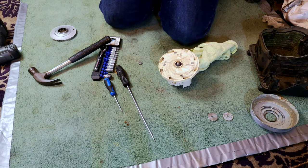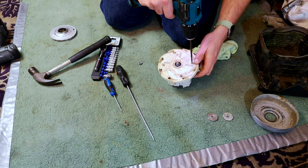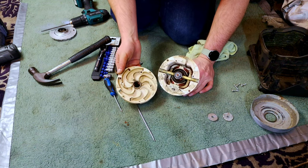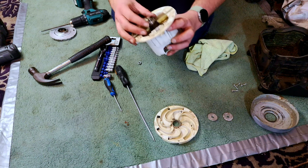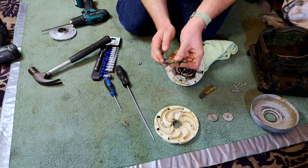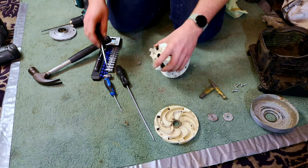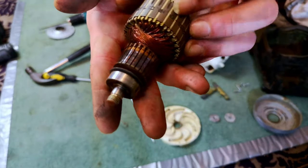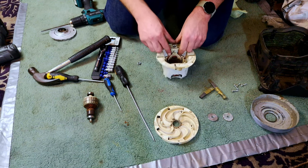Then we need to go back to our T20 and undo these four screws. I think I'm just going to give the motor a wash, clean all this up, and then call it done. This has been wet and it's not running particularly beautifully anyway - it's a high-mileage Miele motor, sounds like, looks like. Carbons are okay though - a little bit of excessive sparking, but you can understand it on this motor. The bearings aren't too bad. The armature is certainly used, but not abused. Overall, it's okay, I think. I'm just going to wash the fan and drop a bit of oil in the bearings.